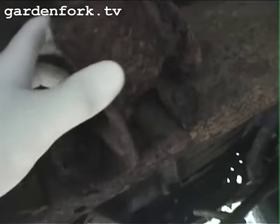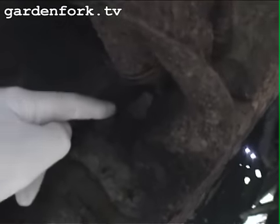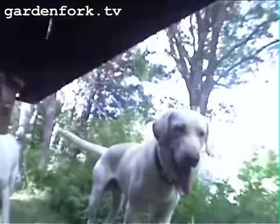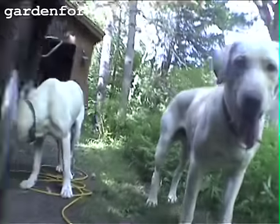This is your shackle bracket. This is what's broken. Up here is a leaf spring with a connection to the shackle bracket, and the shackle bracket used to be connected to the frame right here. So we have to take these bolts off, and we have to take this big bolt off as well. So I have to cut the bolt on this side where the nut is, so we can drive the bolt out that way to where Midge and Henry await.